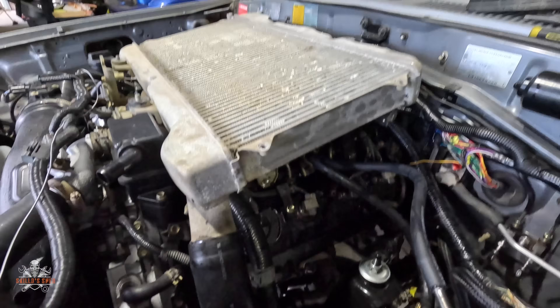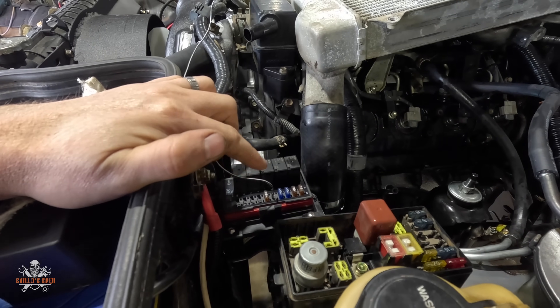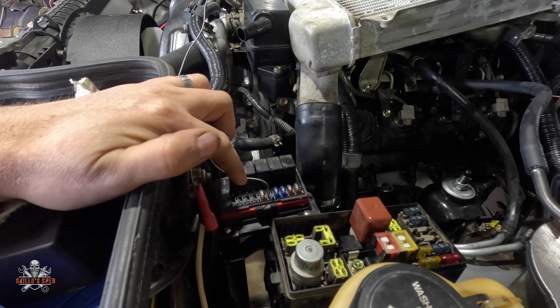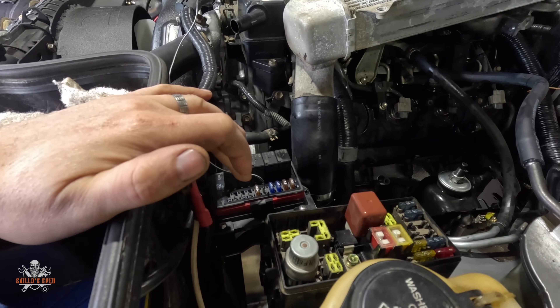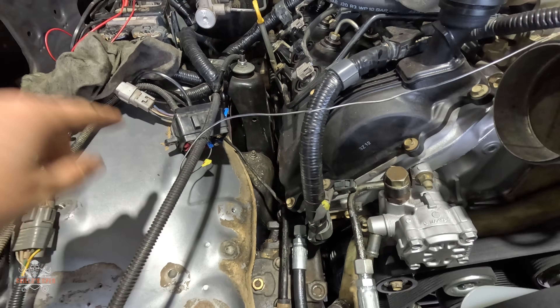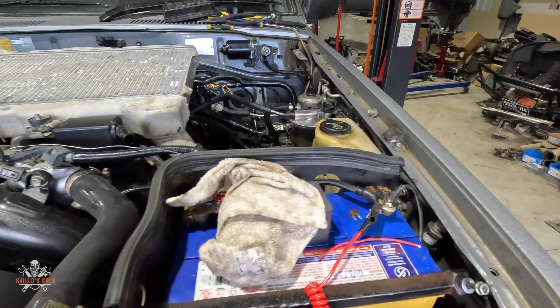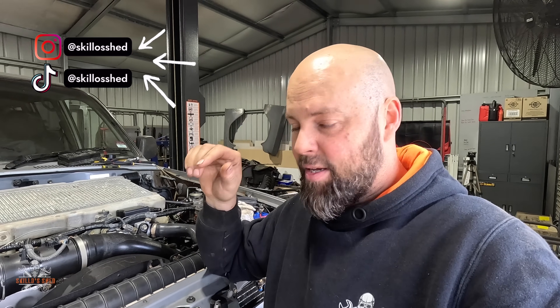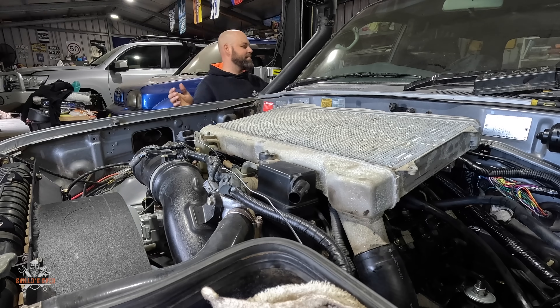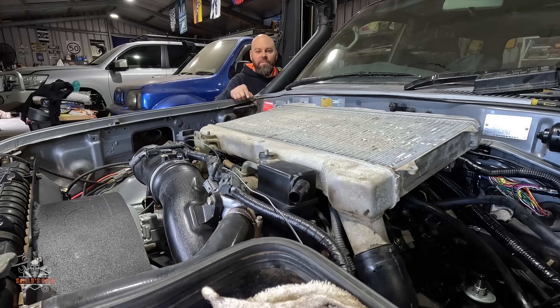I had to reopen this one here, pull that through, hook up the right wire, and I've now got crank — which is good. I just need to retape all that up. The only other thing I was missing is the ignition feed — there's an ignition fuse that goes to the ECU, so without it the ECU doesn't work. I've had to just hot-wire a little wire to an ignition feed and I'll re-sort that later. I've just rung Hagen about it and he thinks it might be something going on with the ECU.